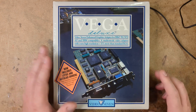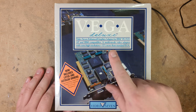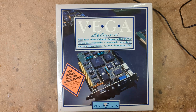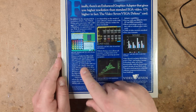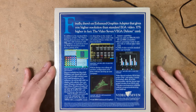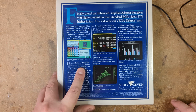Hello! I've got a bit of a special treat today. We're going to be playing with a sealed new in-box graphics card from the mid-1980s. It's a Video 7 Vega Deluxe, and it belongs to the class of graphics cards often known as Super EGA cards. Whereas standard EGA cards only went up to a resolution of 640x350, the Vega Deluxe claims a top resolution of 640x480. To allow you to actually use these resolutions, it comes with drivers for Windows, AutoCAD, Lotus 1-2-3 and a bunch of other software, so there should be plenty of stuff for us to test today, assuming I can find a monitor capable of displaying these weird resolutions. Let's get into it.